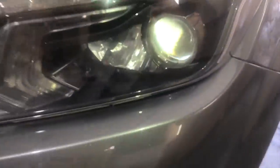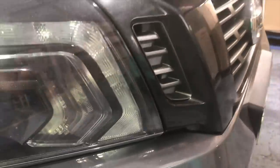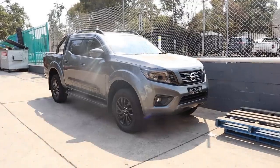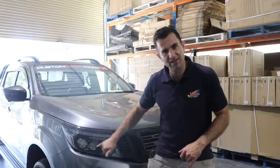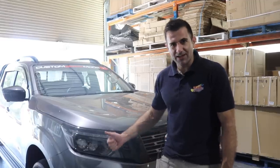Gone through the whole process. I've pulled the headlights off the car, chucked them in a makeshift oven and melted the sealant around the headlights, pulled them apart, unscrewed the inside plastics, gave them a quick scuff and adhesion promoter, then I painted them with my custom metallic black. I also painted a tinted clear over the chrome bits in the middle over the projector, and that gave it a black chrome look. Then I used some fresh sealer, sealed it all up, and chucked them back on the car,